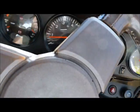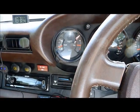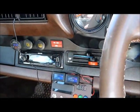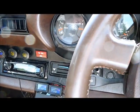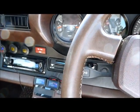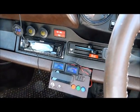It draws about 40 amps when it's running. This car's just got a standard SC alternator at 75 amps, so it's about equivalent to having the headlamps and the rear demister on. We'll be doing some work to protect the car from draining the battery, so there might be some compromises — we might not be able to operate it with the lights and demister on. The alternative is to upgrade your alternator; we're looking at 120 amps.